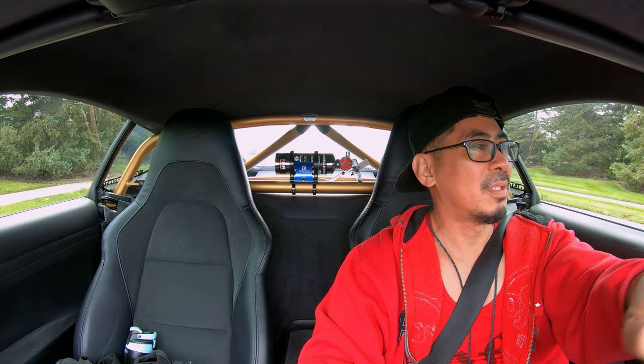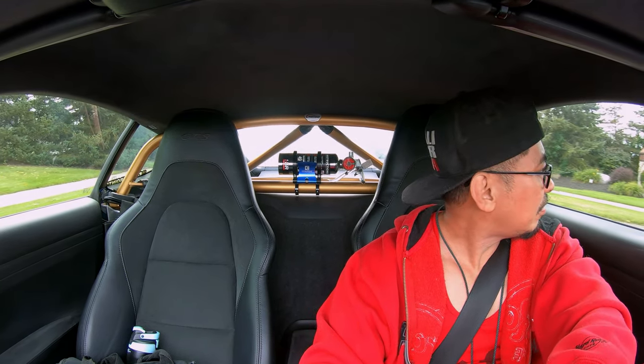All right, let's see how it feels. Also wanna see how it feels. Shouldn't it be any different with these 245s? Feels good, guys. Now, you don't want to slam on the brakes. You just kind of want to do a couple stop and go. And because I did wash the car, I do have that surface rust. So hopefully on these first couple stops, it'll remove those. We're just kind of breaking them in, you guys.